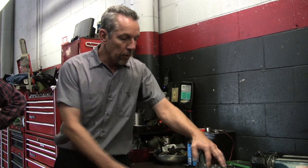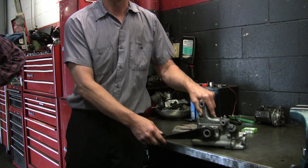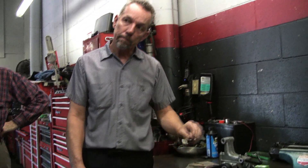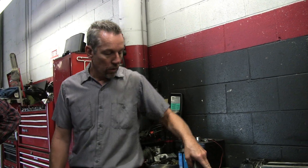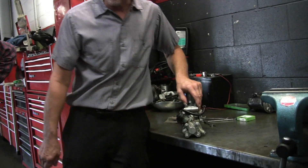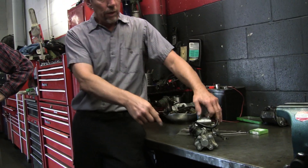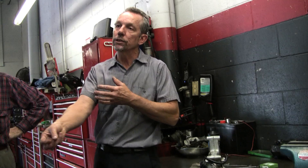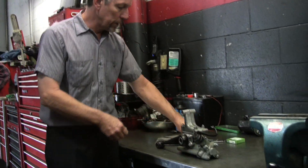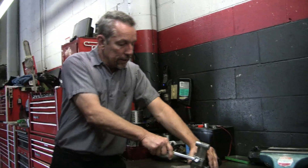This one has plenty of fluid, but it was leaking, and we can't have that on Gene's car. What the servo controls is just the valving in here — it takes the fluid and passes it back and forth through orifices, and it just changes the orifice size. So I'm going to drain it out. The fill plug is here, like I said.